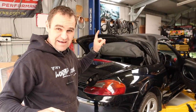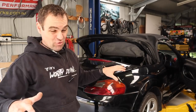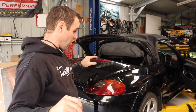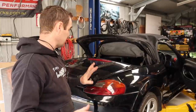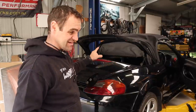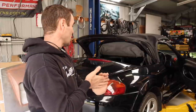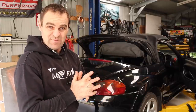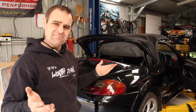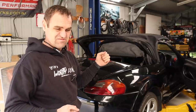So we learned a couple of things. I had the engine cover off and was revving the engine, and from the top it's not moving at all — zero movement, rock solid, not even tilting side to side. Power steering is leaking like a sieve, absolutely pouring out. I think it might be one of the fittings to the hoses going into the bottom of it — we need to get under there and tighten those up. The squealing seems to be better. I'm also going to get underneath and have a look at the brake pedal and see if it's just sticky.